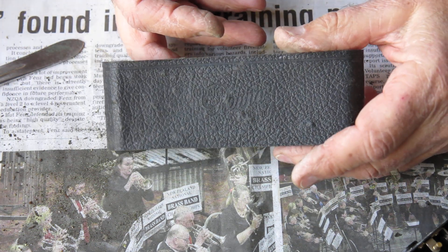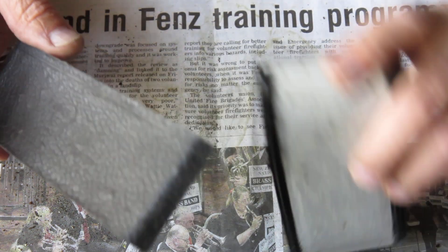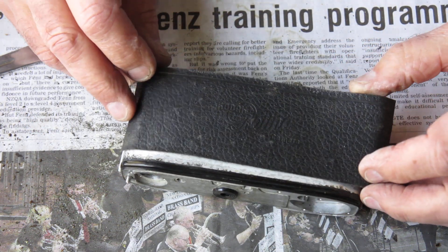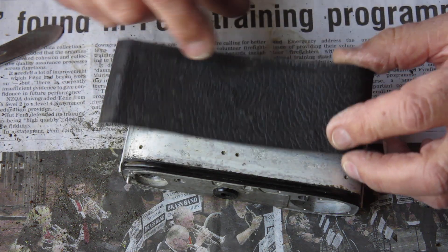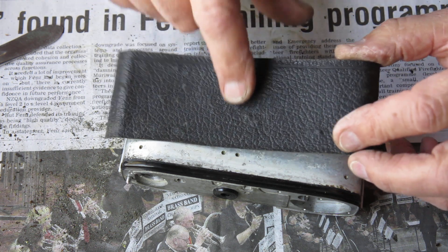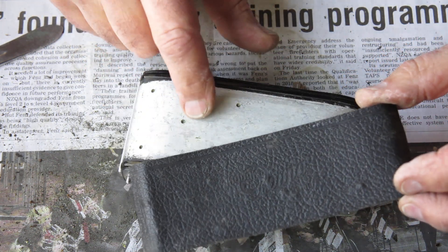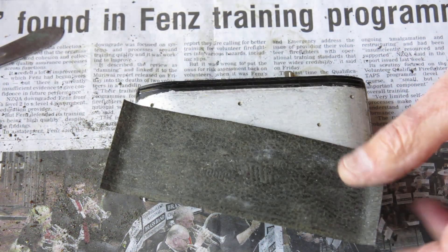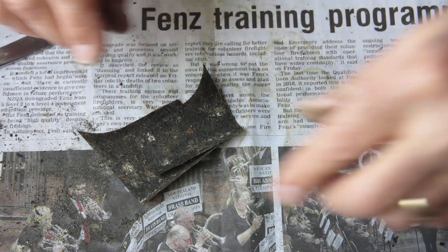You can see the lumps and bumps that show through — these are the Zeiss bumps. Most of those Zeiss bumps will line up with something here. This big bump here is over that patch of corrosion; the bumps line up over that patch of corrosion. That's why you get Zeiss bumps — it's a build-up where that corrosion expands.